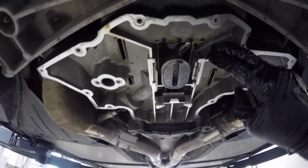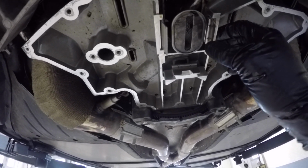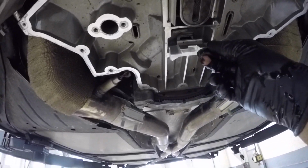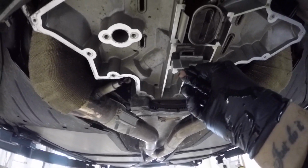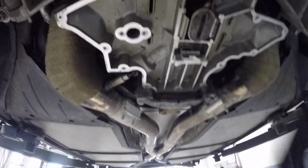For those not still understanding how it works, imagine there's oil filled in the bottom of this, right? So you go to take a hard right-hand corner. This door is going to shut, preventing the oil from going away from the oil pickup. Let's say you are accelerating very quickly. When you brake, this is going to open up, allowing oil into the oil pickup. But when you hit the accelerator, it will close in order to keep the oil by the oil pickup to maintain oil pressure.